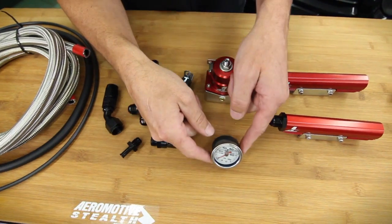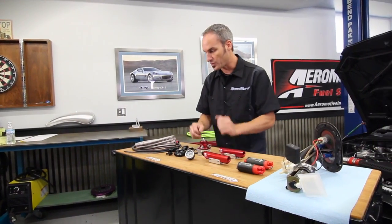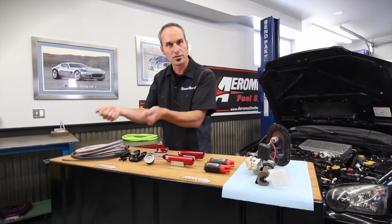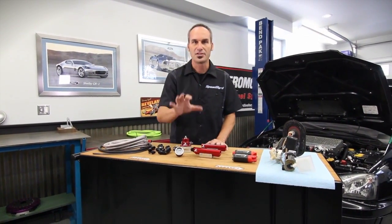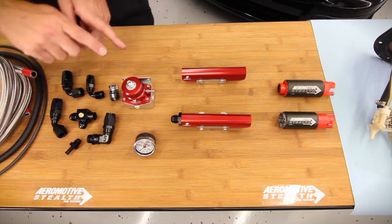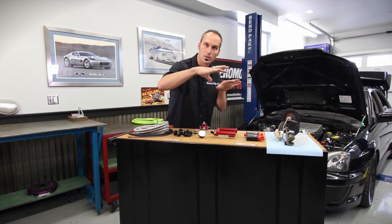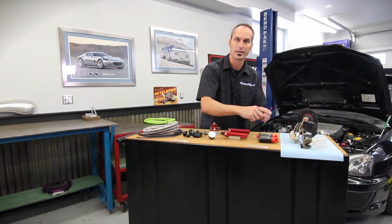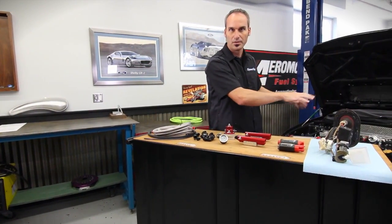You want to monitor it — plug this guy in. It comes with the kit. This is their equalizer, a liquid-filled fuel pressure gauge. So everything you need to plug and play: you literally pop the pump in, don't change anything. When you get up to the front, you've got some adapters for your feed in and your feed out, and you're done. A cool upgrade they do is go from a series setup — fuel coming into one rail, into the other rail, and back to your tank — to coming in with a Y, splitting back together on the other side, separating the two halves. Your fuel flow lowers in speed per rail, a little bit better dynamics, lets fuel turn into the injectors a bit better, then they bring it back together and tie back into your stock system. This is a great way to do the upgrades to support just about anything you want to do on one of these rides.